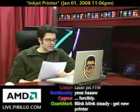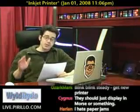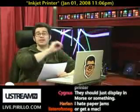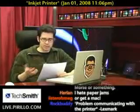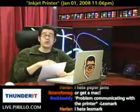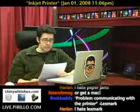Number five, saving the worst for last: reinstall the latest printer drivers. Yes, it's that age-old trump card that any computer tech throws down when all else fails. But seriously, printer drivers can become corrupt for any number of reasons. Uninstalling your printer software and then reinstalling the latest drivers from the manufacturer's website can do nothing but good things for you, even if it doesn't fix the problem at hand. Many times the problem can be fixed by popping in the CD that came with your printer. If your CD-ROM is set to autoplay, it should give you the option to uninstall or reinstall the drivers. You won't get the latest drivers that way, but you will get the original drivers your printer came with and the ones it was using when it worked properly.